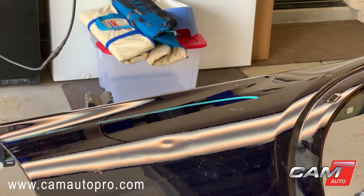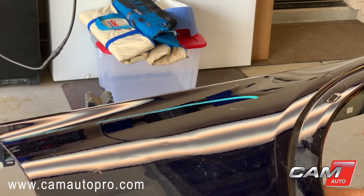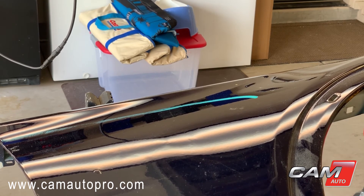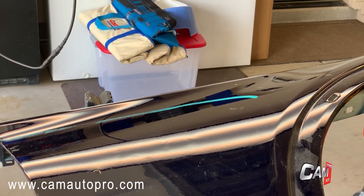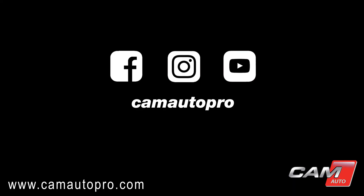I'll go for the next one here. I'll show you the back side of the panel shortly as well. I'm not going in any particular pattern — just dragging that tip of the induction machine across the backside of that panel. Very quickly brings that metal back out. It's a very good product.